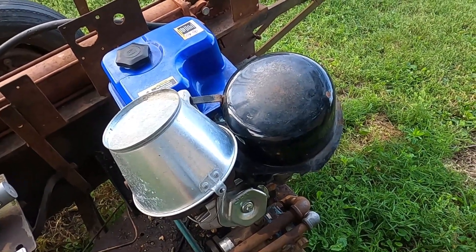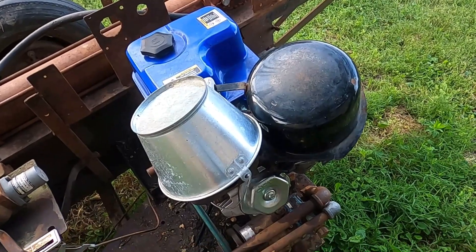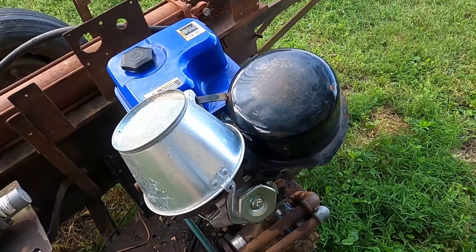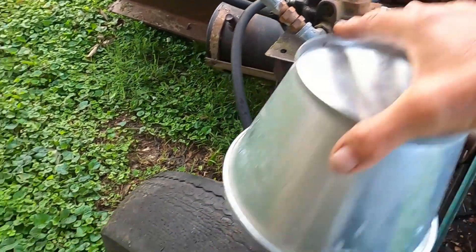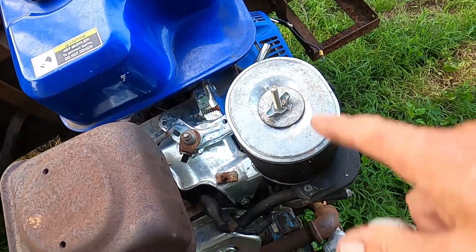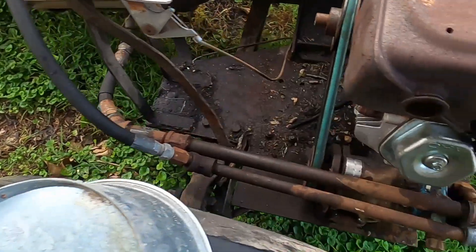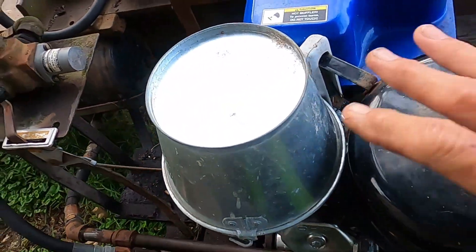Got the water out, let it sit and air dry. The engine was locked up. Took the spark plug out — the cylinder was full of water, just everything was full of water, because the engine had been left sitting covered. Holes in the muffler were allowing water to get in, and not having the top part of the air cleaner on — because it doesn't exist — allowed water to get in. But oddly enough, the gas tank was completely devoid of water and fuel; no water, no fuel, nothing in the carburetor.